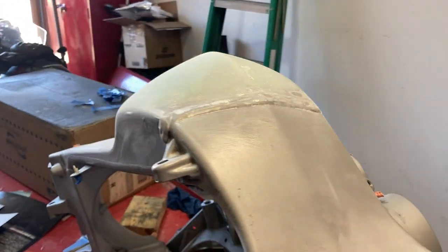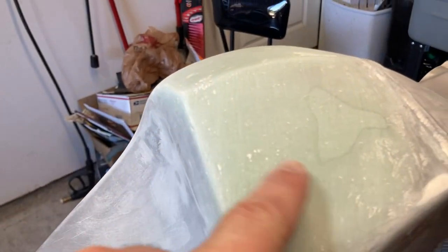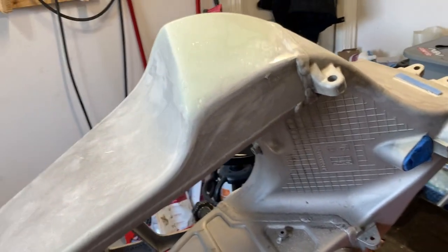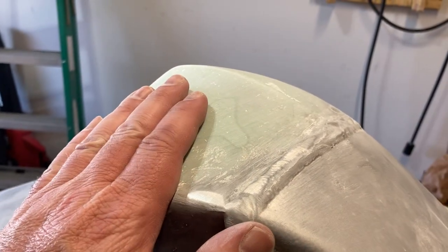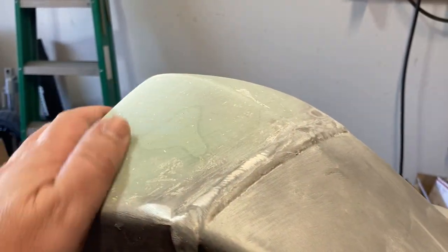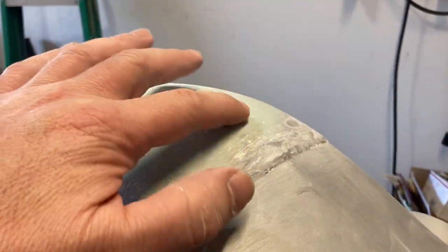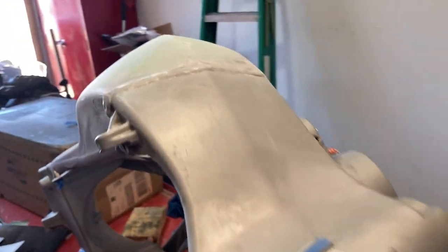Well, I just wanted to do a quick catch up. I got some inclusions that are in that top layer of fiberglass. Everything else down below is that metal impregnated Bondo stuff. I went with the fiberglass top layer because it's so hard and it tends to do a pretty good job with being more resilient than regular Bondo. For a lot of these inclusions, I am just gonna use regular old Bondo and fill those in.